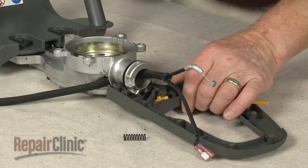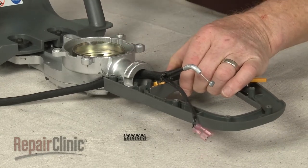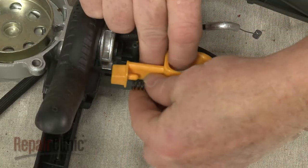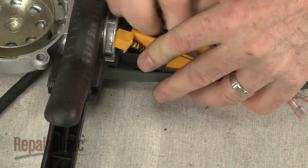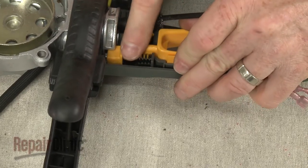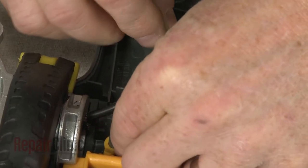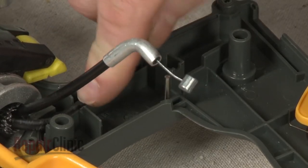Realign the handle base and use a clamp to secure it. If the handle lock spring has become dislodged, reposition the spring on the lock and reseat the lock in the handle base. Realign the locking rod and the rotator. Align the on-off switch wires in the groove in the handle base.